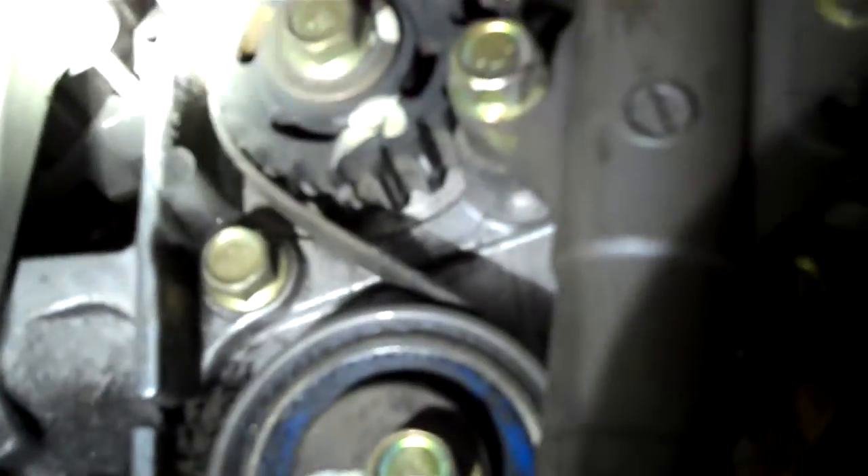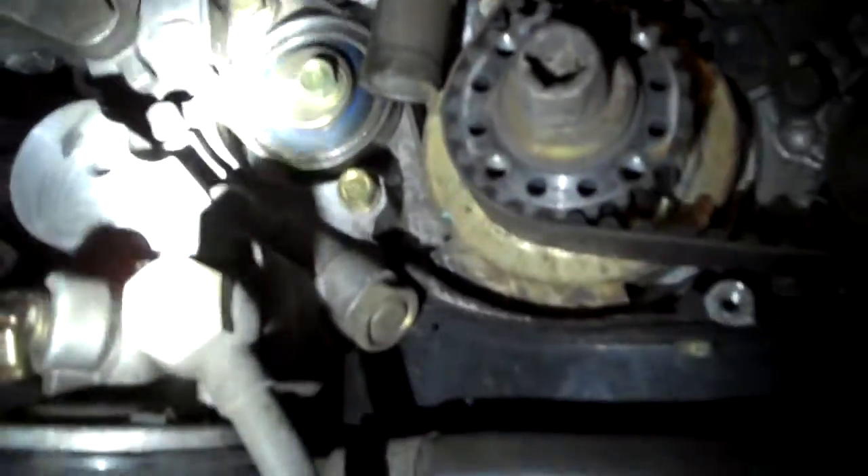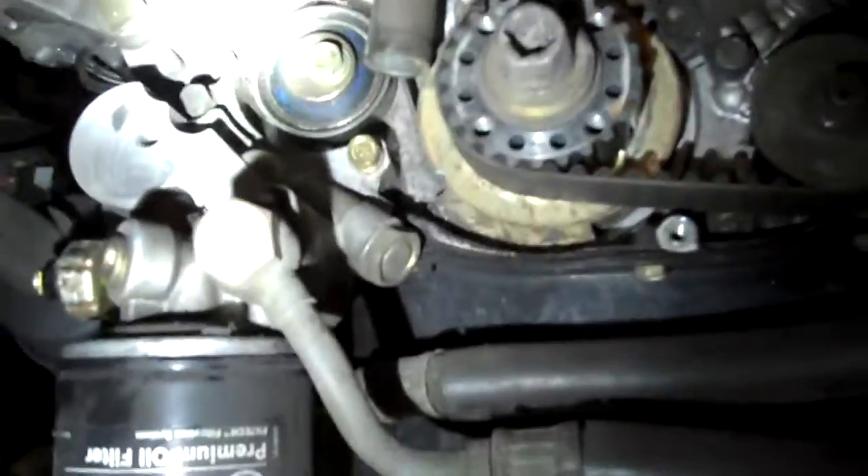But if you have a weird whine from your engine and none of the pulleys seem off, you could have a balance shaft belt going to heck. This car has 95,000 miles on it but it does have a good amount of horsepower.